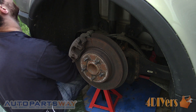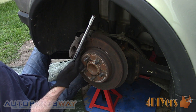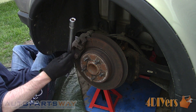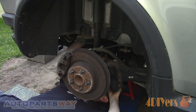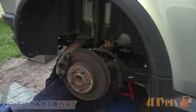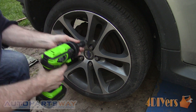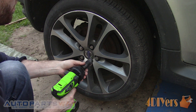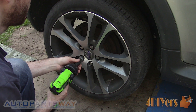You'll need to go under the car to tighten the bolt on the subframe side. Here is the extension I used to access that upper bolt. Reinstall the module with the three Torx screws — after the bracket has been bent, you can gain access using a screwdriver or ratchet. Reinstall the wheel; the torque specifications for the lug nuts are 80 ft-lbs or 108 Nm.